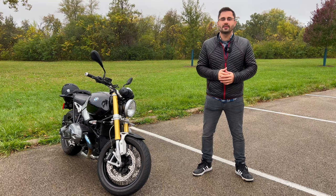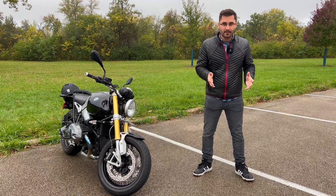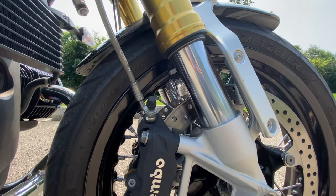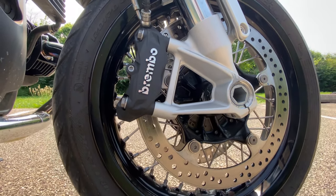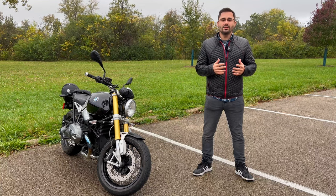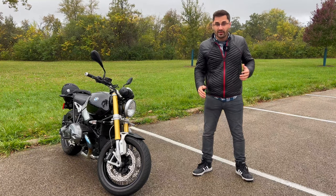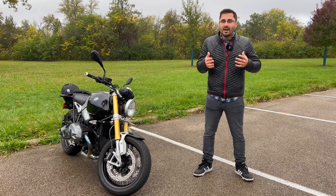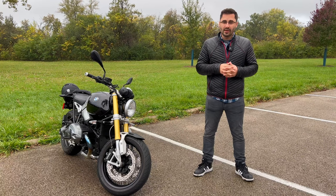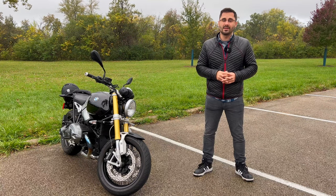That's a good thing in my opinion, as there are way less things to go wrong with it, and it also means the bike can be a keeper for many, many years to come. However, there is one issue that has been coming up in multiple forums and groups that I follow: the ABS sensor. It seems that a lot of people have been experiencing issues with the ABS sensor going bad, which disables your ABS and traction control, but also causes the speedometer and odometer to stop working. This is an issue carried over from the GS crowd as it uses the same design. Some older models have also had problems with the wire loom to the headlight, where the wires move around as you're riding and turning the wheel and eventually fail. BMW fixed this on 2017 plus model years with a plastic sheath that goes over the wires and protects them, so it might be a good item to look into if you have an older bike.